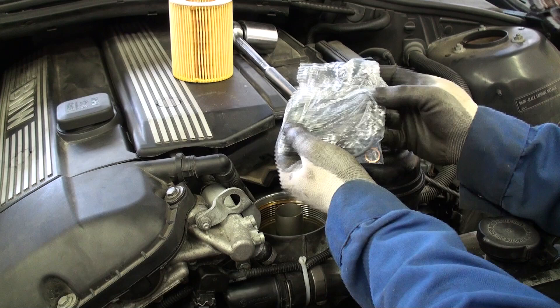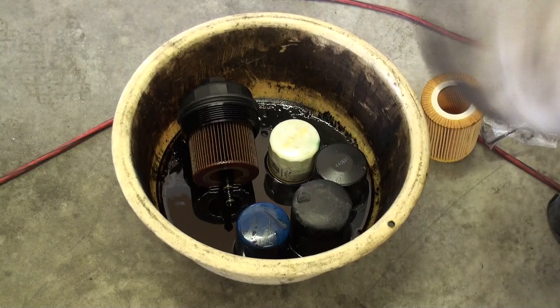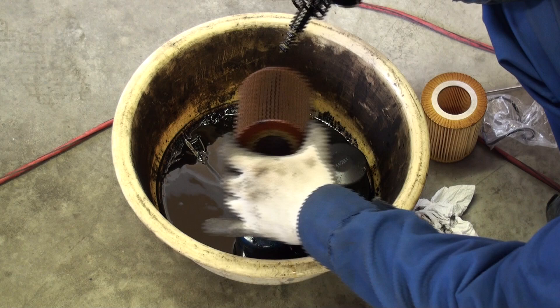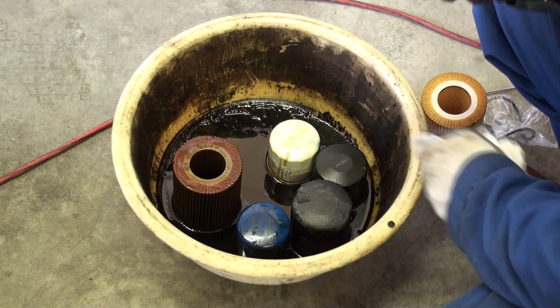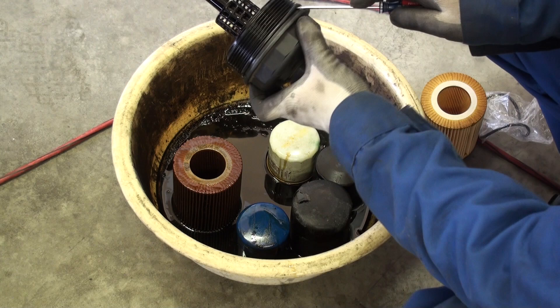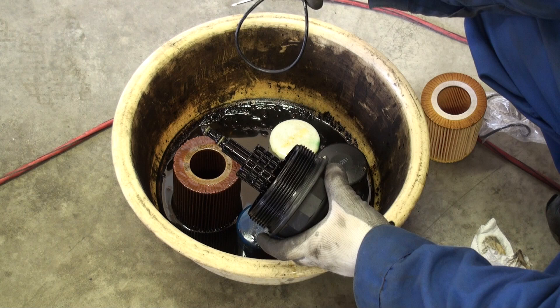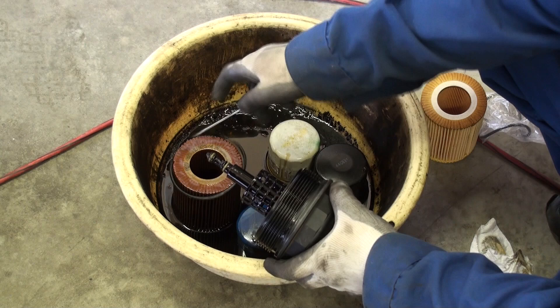To service the oil filter assembly, we need to clean up the lid portion of the oil filter, carefully pull the filter off of this cage, and then using a flat-bladed screwdriver, pry underneath this gasket to remove it. To reinstall the new one, simply slide it back on — preferably by hand, or if using a tool, be careful not to nick the surfaces of the gasket. Prior to reinstallation, apply a small thin film of oil to ease the install.